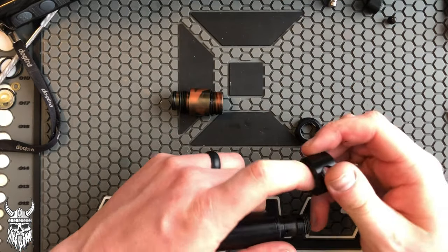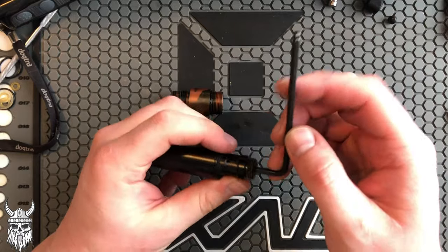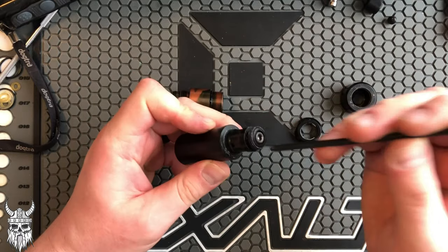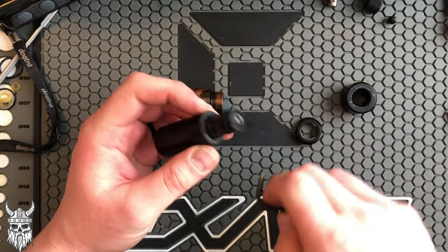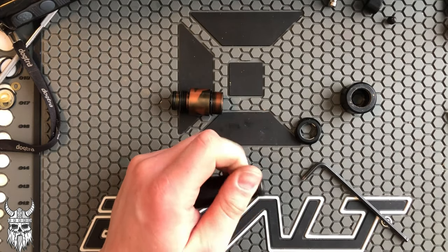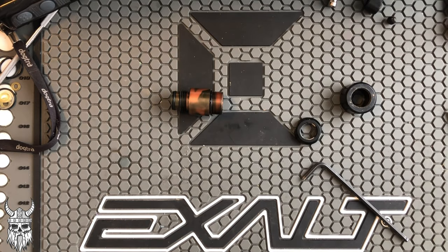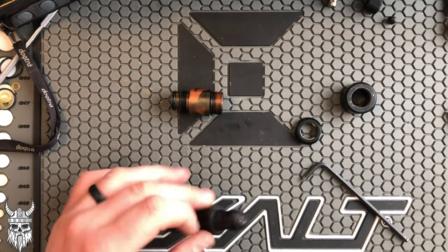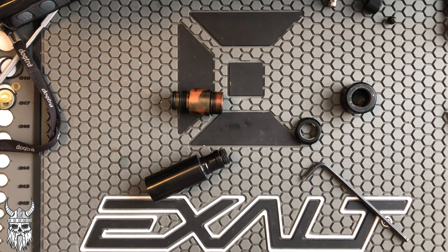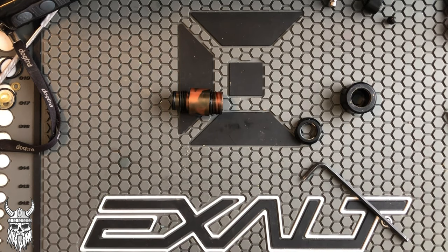It is dry. So something you don't want to do is put it on the adjuster here and try and back it out, because you're just gonna screw up the threads in there. What you want to do is get your strap wrench out again. That's kinda being a pain. Hit this with a little heat.